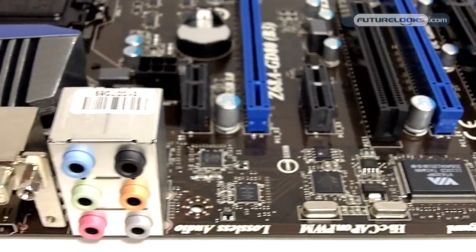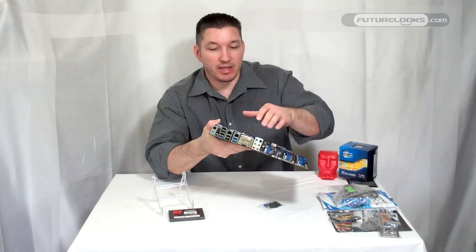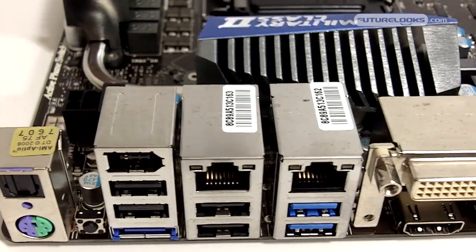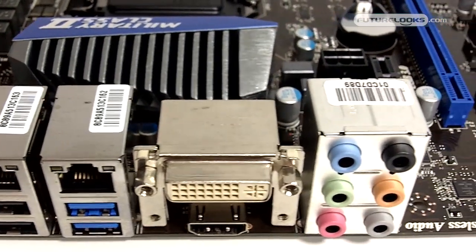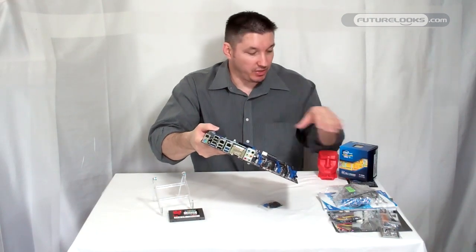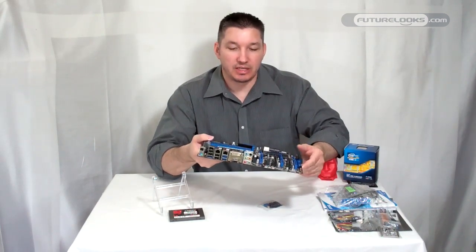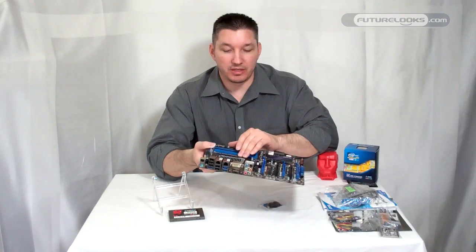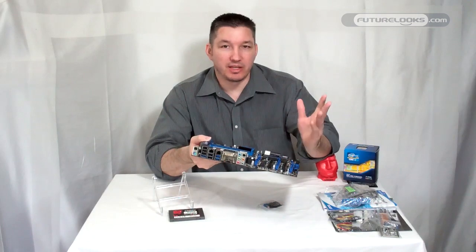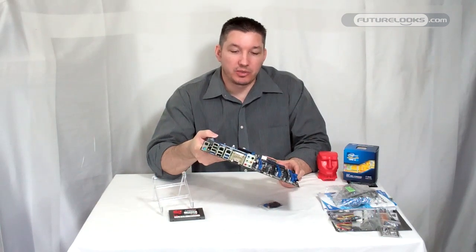Here on the back, you've got your six analog standard ports so you can connect your choice of speakers — Creative Labs, something from Antec, maybe Corsair. You've got two video outputs here: a DVI and an HDMI out, the latest interfaces. Those give you access to Sandy Bridge's integrated graphics. For users on Media Espresso or doing any transcoding, that's a whole lot of performance just off the processor itself. Otherwise, you can have two monitors running at a time — one off your video card to play your games, and one off the video output here for a little extra productivity.